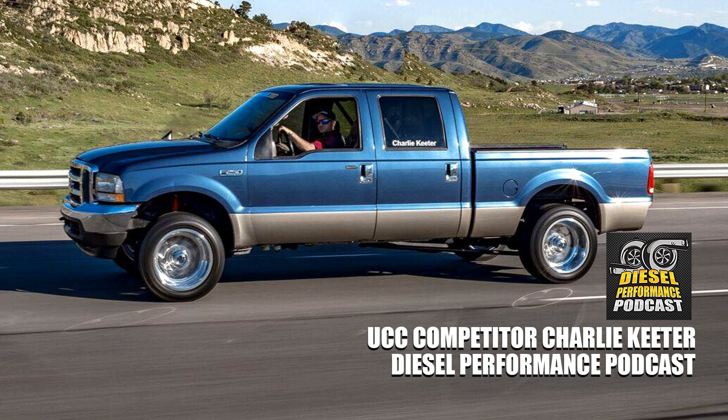The 911 bottle has a ratio listed right on the side — it's never a full bottle, but it's also not going to do anything when it's 20 below and you're already gelled. You pour the 911 in the tank and it's not going to magically work its way through the fuel lines, fuel filter, injection pump, rails, and injectors. The best solution when totally gelled is to bring the truck inside. People say they let it idle for two hours — of course it died, you're not mixing that fuel.